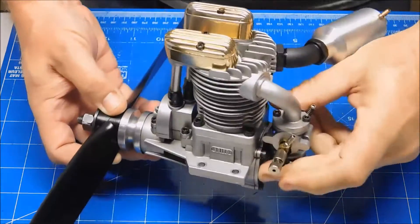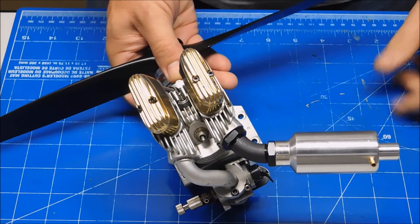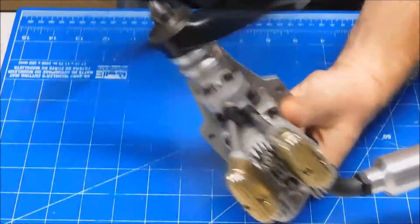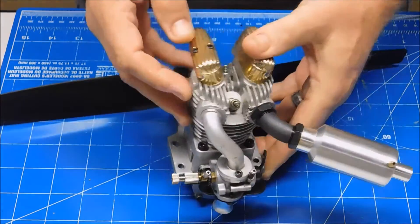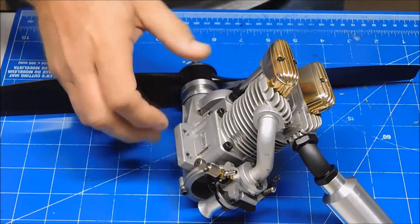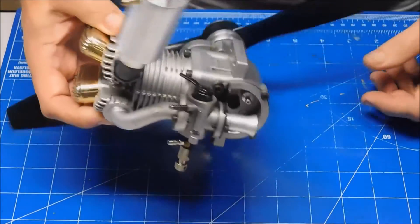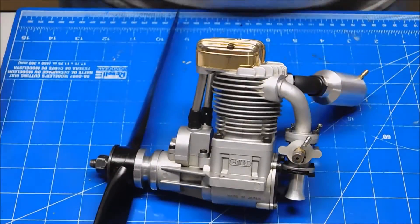Reassembly of this engine is complete now. I'm going to be using this exhaust and header until the other exhaust I bought arrives, and this header I may end up having to keep. But you can see it's got pretty damn good compression. Hopefully I'll get this thing run today or sometime this weekend. Right now I just have two Fox Miracle plugs in it. I need to see if I've got a brand new OSF plug to put in one of the ports. The Fox Miracle plug in the front I'm going to keep — it's a good plug, it glows — but I want to at least put a Fox or an Enya plug in there. Overall this engine turned out quite well, and I can't wait to get it running.